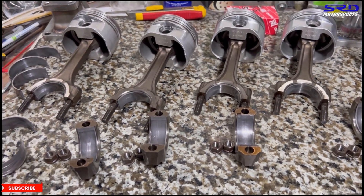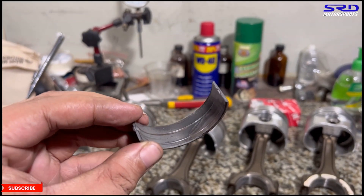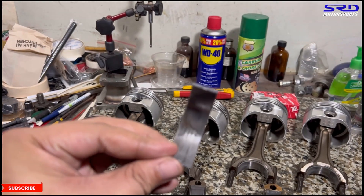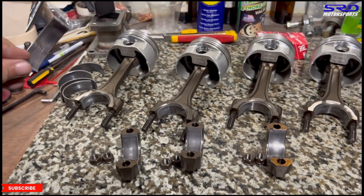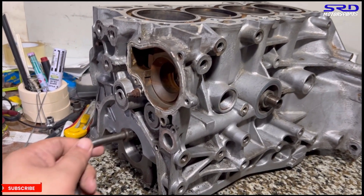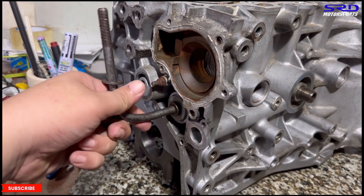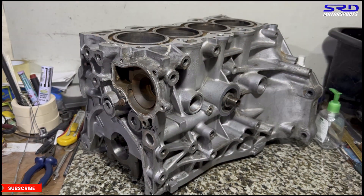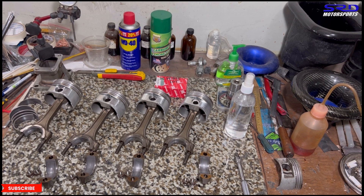Sure, the engine won't blow up immediately, but this is definitely not fresh and it could be robbing power — you're trying to shoot for proper oil clearances but your bearings are already worn, which is kind of useless. Watch the video on cleaning parts before final assembly — it's very important. Before going on, you have to watch the how-to-clean video because removing this plug lets you clean the oil passageway that leads to the main bearings. If the head or block was resurfaced, honed, or machined, there will be debris that causes harsh wear during startup.